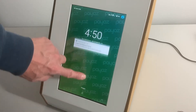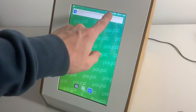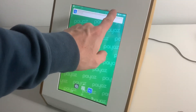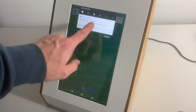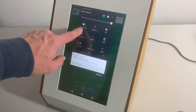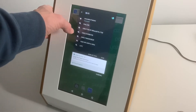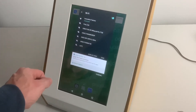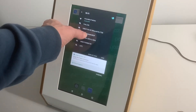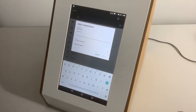When your device comes on for the first time you'll see that it's locked, so just grab the little padlock on the bottom and pull up — that will unlock the device. The next thing you'll want to do is set up your Wi-Fi. The easiest way is to go to the top right-hand corner and swipe down. You'll see some icons appear, and the Wi-Fi one is in your top left-hand corner. Hold that and you'll see a list of Wi-Fi connections come up, then just select the one you wish and put in the password.